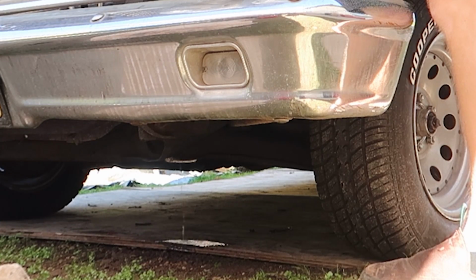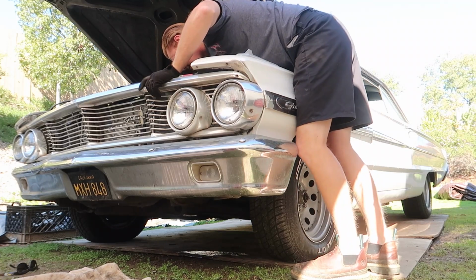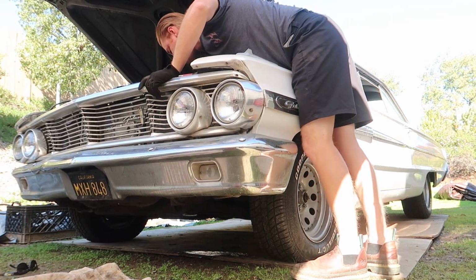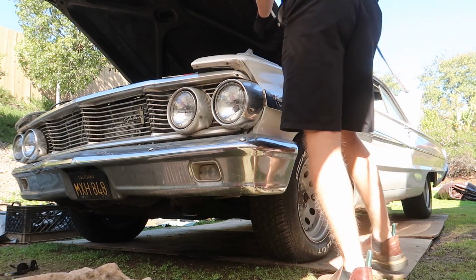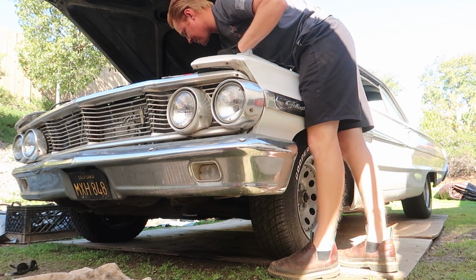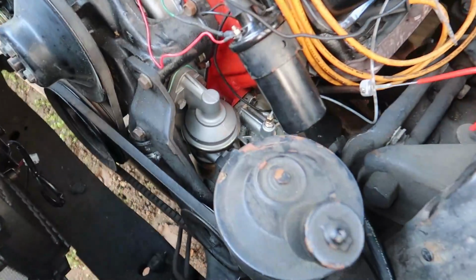Okay, that works. That is draining fuel. Okay, now I'm gonna take the top line off, see if it still comes out. Okay, so the tank's not clogged, so that's good. But that also tells me that something's not going right here. All right, so the culprit is definitely the fuel pump. Good, and just turn it over for like 4 seconds.